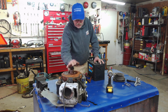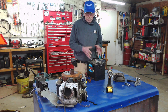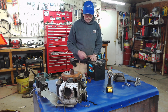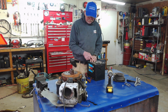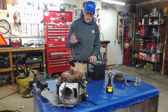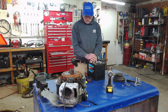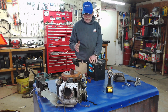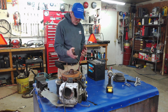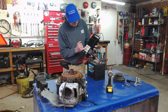So, simplistically — imagine this is still sitting on your lawnmower. This is your battery, though this is not a normal lawnmower battery; this is a deep marine, but I thought bigger is better. You have your ground and your positive that are hooked to the system. And what it's hooked to is coming from the stator to the starter to the PTO clutch — everything is all intertwined. So the way to start eliminating things is while you're all hooked up and your engine is running, you put the negative here and the positive there.